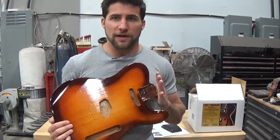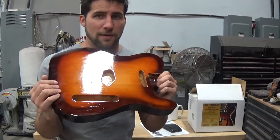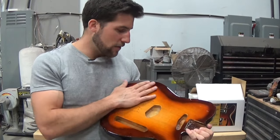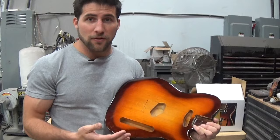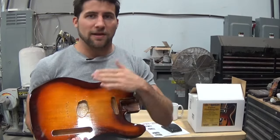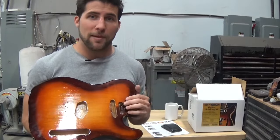What we need to do involves the sanding and polishing process. Once you've got your clear coat on, it should look pretty shiny, but to get that beautiful mirror finish we have to sand the clear coat perfectly flat — taking out any imperfections, scratches, or orange peel — and then polish it back to a high gloss. We'll start with the 800 grit paper, use the wool lube to lubricate it, and work our way up through the grits all the way to 2,000.